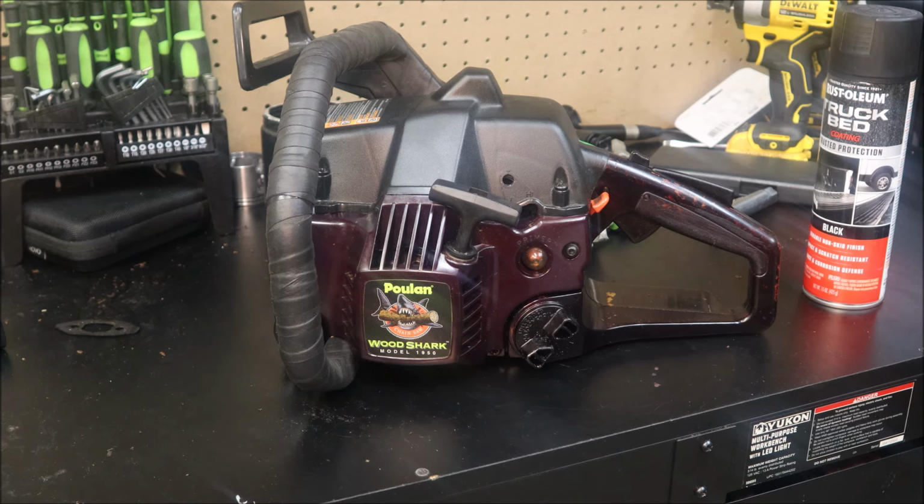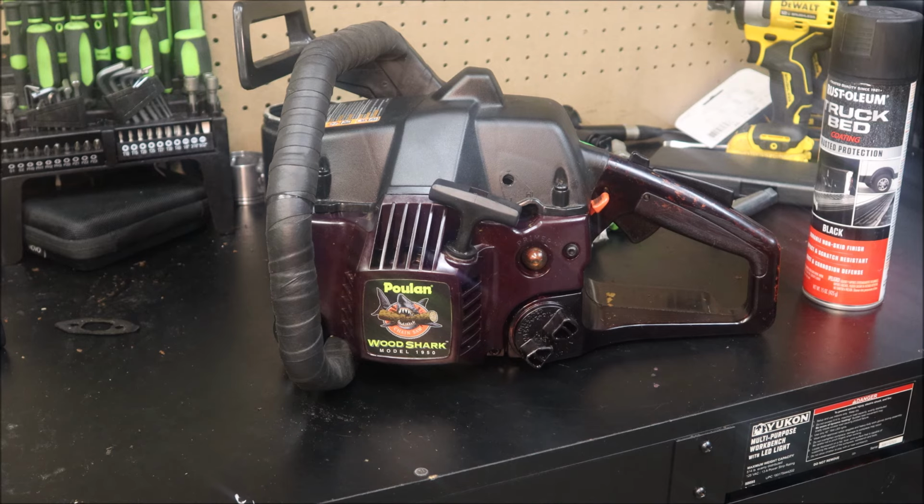bust off? I hadn't had it running in forever before I tore it down, but I did find one of the lines, whoever had put lines in it, the return line was just kind of stuck, like at the top of the tank, notched and just pushed there, so I'm not even sure how it was running as good as it was before, because it had to be causing an issue, an air leak, or something. It had to be causing fuel issues.